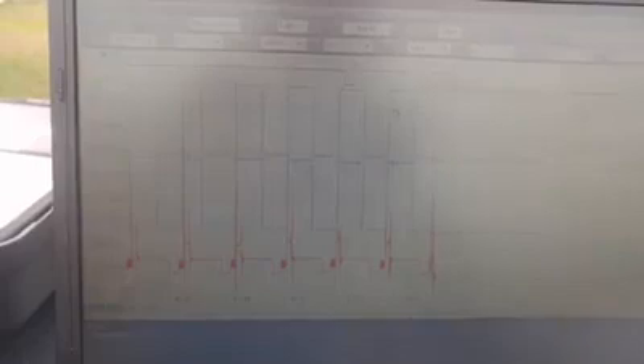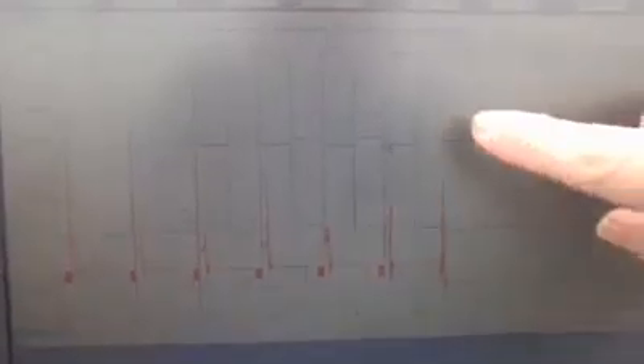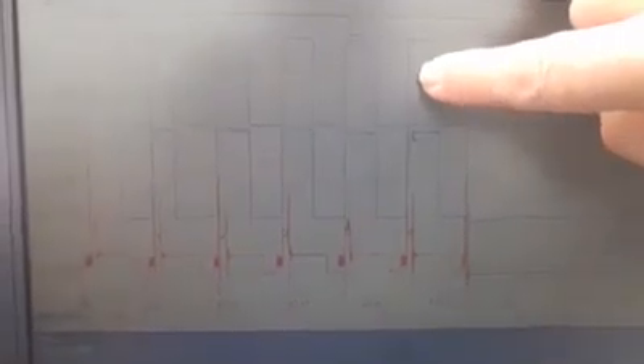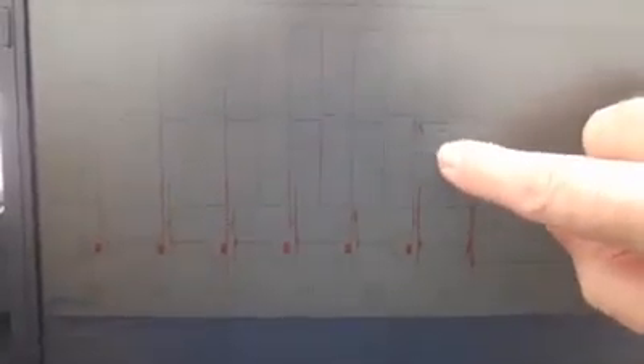You can see that when it's shut off, everything dies immediately. The spout signal is identical to the PIP signal anytime the spout is unplugged. When you plug the spout in, the spout signal starts moving around with timing as the computer controls it, and the PIP signal remains the same but adds the notch. The car has been sitting here running with the spout connector in for five or ten minutes now, and it won't stall.